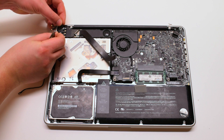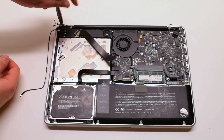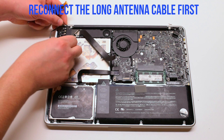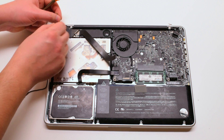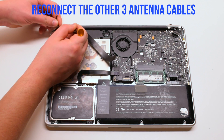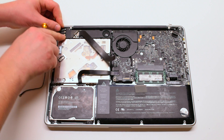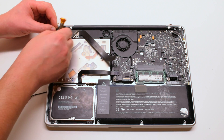The second cable also has a little metal loop — loop the Phillips head screw through it. Go ahead and reconnect the antenna cables starting with the longest one first, then the next three. They're all different lengths, so make sure you're connecting the longest one next every time. They pop right in if you place it right over the socket hole and press it in with your finger. Make sure it's firmly connected.